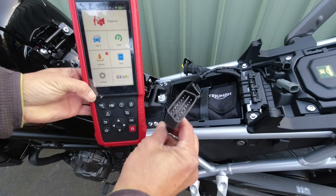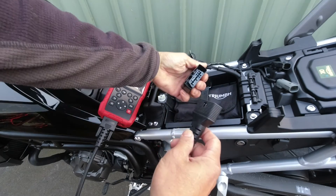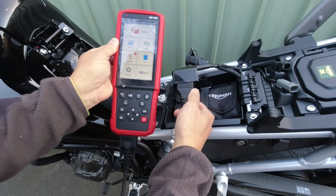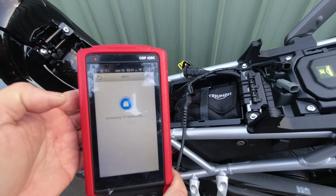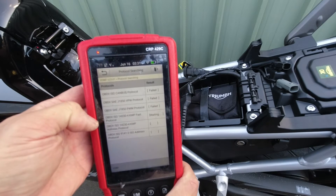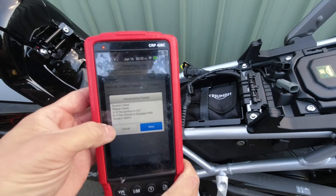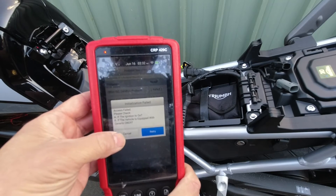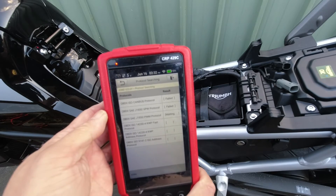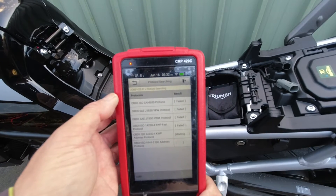I've got the OBD2 cable connected. This is the OBD2 cable on the scanner — you can see the male pins. I'll now connect this plug to this socket. It's connected. Let's press OBD2 and see if it reads any error codes. I don't know what 'fail' means — it says 'excess fail.' Making sure it's connected with generic OBD2 and that the ignition is on. After retrying, it looks like the car OBD2 reader cannot read the motorcycle OBD2, even though the physical interface is the same.